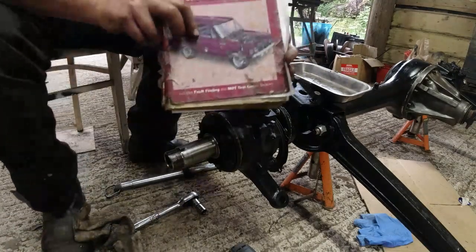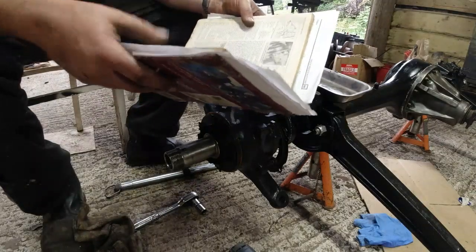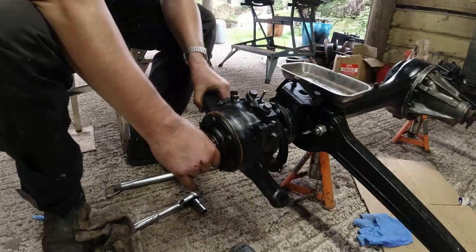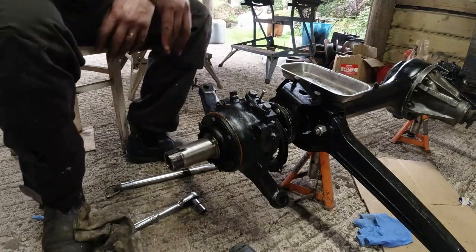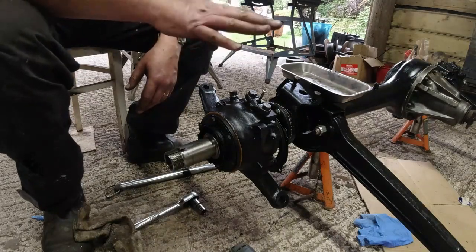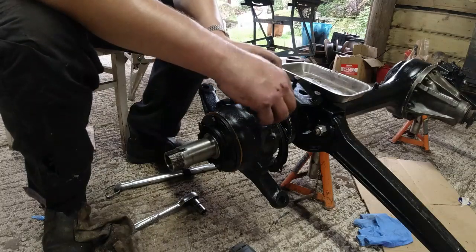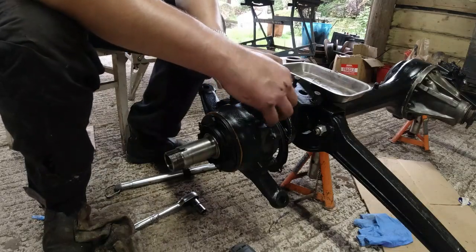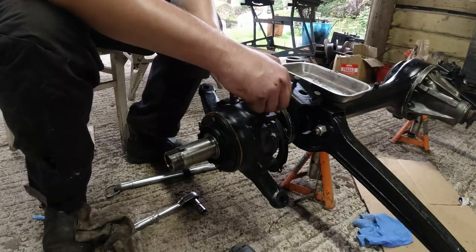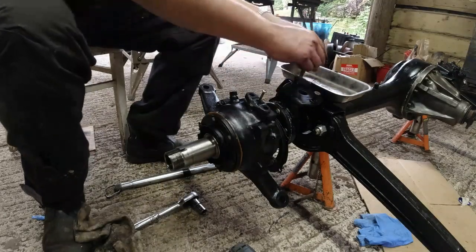Good old Haynes. The process is actually detailed really well in the front and rear axle section, but effectively you've got the bottom swivel pin which is fixed and you've got the top swivel pin. When you do the top swivel pin up, it will compress — because you've got two coned bearings in here — between the top and the bottom swivel pins. What you basically need to do is fit the right number of shims so that when you pull on the hub, it responds at a specific torque.